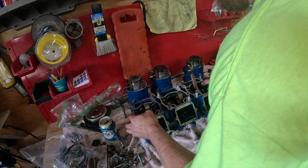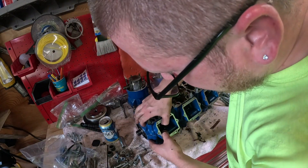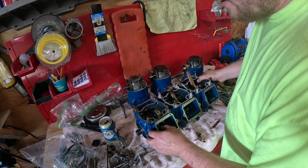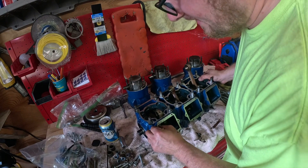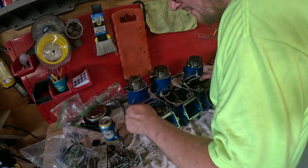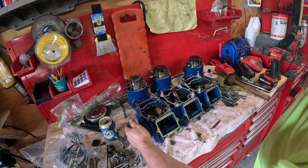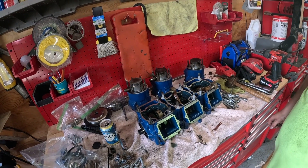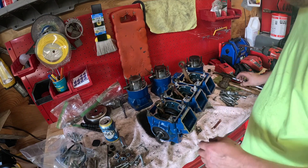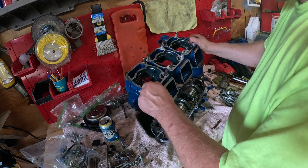Watch your rods. The crank seals are going to be glued in with 1211 on this side too, so you're going to have to break that bond. There are probably dowel pins in there, so we'll just keep working at her a little bit, applying pressure and shaking it. What I did is I took my leather mallet and just gently gave it a few taps on that crank seal side - and apart she came. There you go, here's your case.